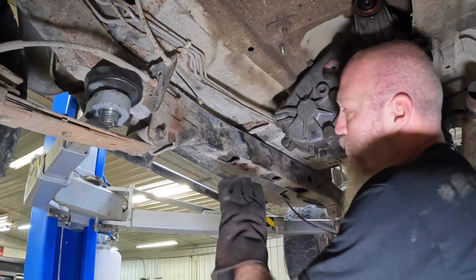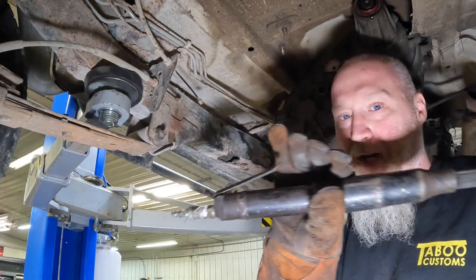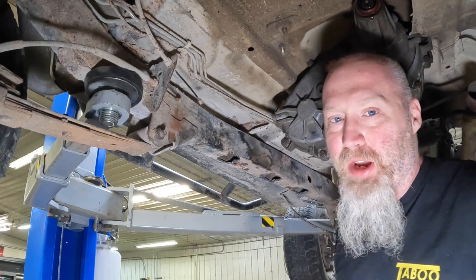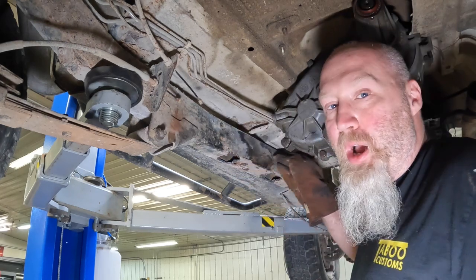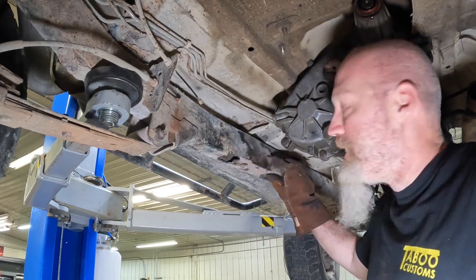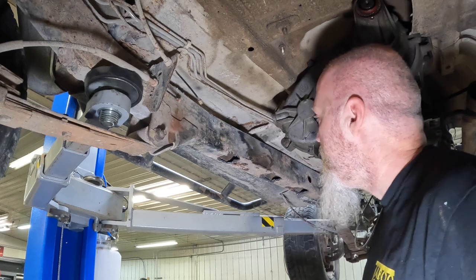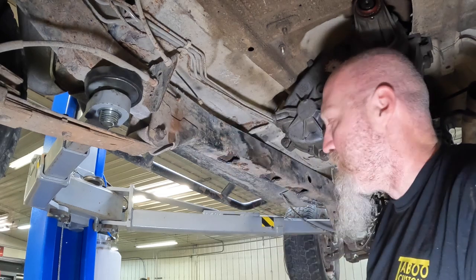But if we're dealing with a really rusty frame, what we will usually start with is a needle scaler, which looks like this if you haven't seen a needle scaler before. So we'll go in, we'll needle scale the frame, take a lot of that scale off, a lot of big chunks, and then we'll go in and we will grind that area. We'll then also go ahead and coat anything that's kind of within that perimeter with that zinc based weld through primer. Then we may even go back and touch it up again just to make sure we've got good metal